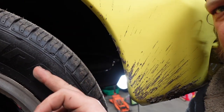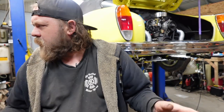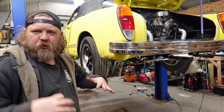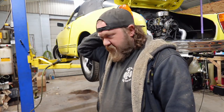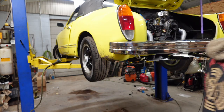And if you've ever hit things, well, the tire strings, good indicator that you have a clearance problem. So, all things being apples to oranges, let me get a measurement off the other side. My lift is level, or should be lifting the car level. I'm gonna measure center line to floor because I know my floor is level, see where we're at, and that'll tell me if we're dealing with a body issue, twisted sag chassis, or suspension issue if it got lowered and someone indexed something wrong. So let me get a measurement on the other side real quick.